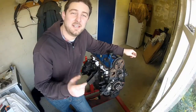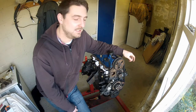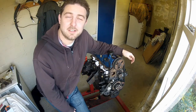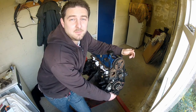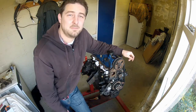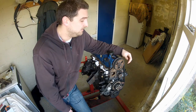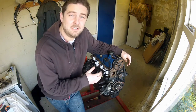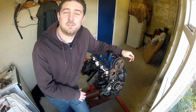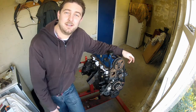Congrats, because that's essentially it. Now to be extra careful, once you've turned the engine over by hand, you can triple check your timing marks just to make sure nothing's amiss. And don't forget there's a torque spec for this crank pulley bolt at the bottom, so you'll need to do that up to spec. Essentially, job done. If you're going to do it 100% correct, after you start the car you should then check your ignition timing. And if you're struggling with ignition timing, check out Tech Tip 04. Awesome — I'll see you next time.